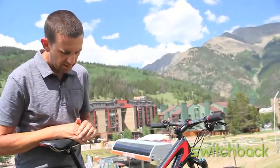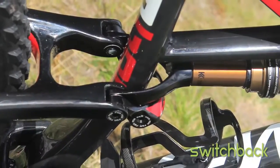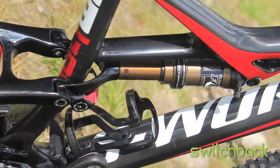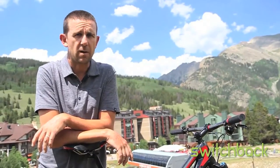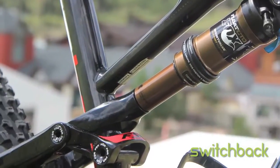Like the alloy bike we did last year, we used a concentric pivot, which gets a lot stiffer. This year we did full S-Works — full front triangle and rear triangle in carbon. We took about a pound of weight out of the frame itself for the S-Works compared to pro carbon from last year. So a significant weight decrease for 2014 in both carbon platforms.